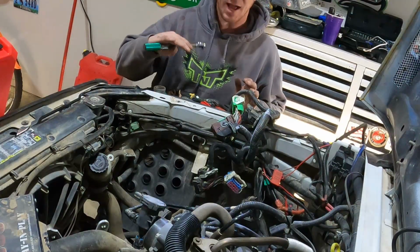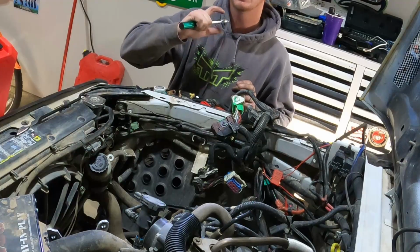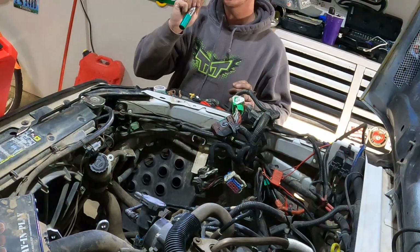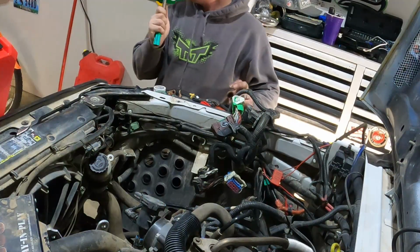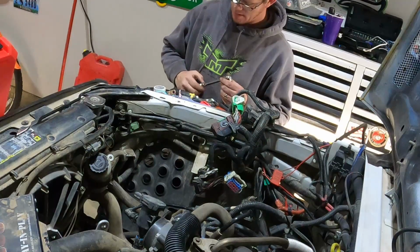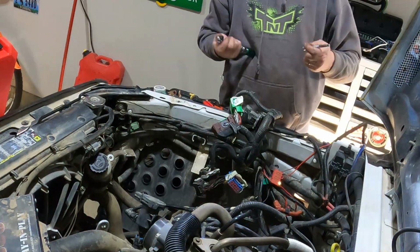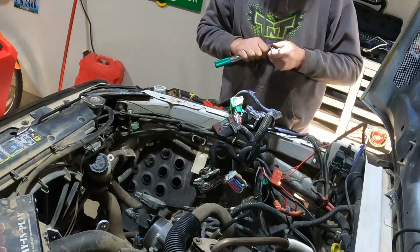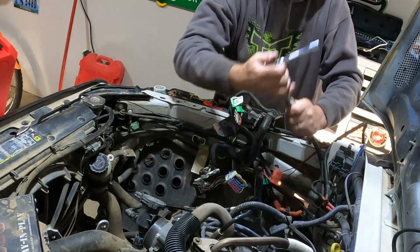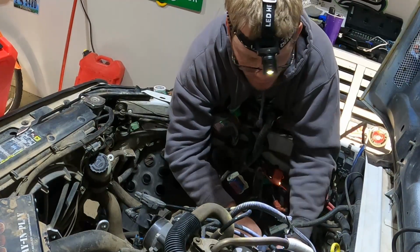All right, so as you apply these, you put the bolts back in the exhaust manifold. You want to make sure you're not going over 200 pounds, so you do definitely need a torque wrench. Got a torque ratchet here, so go ahead and crank this bad boy on there. When you're doing this, you're definitely going to be using every little extension you have for your ratchets just to reach the right way and get the right angle.